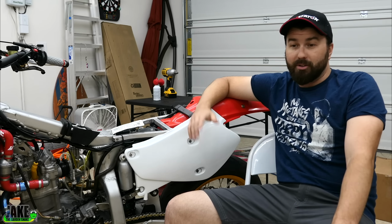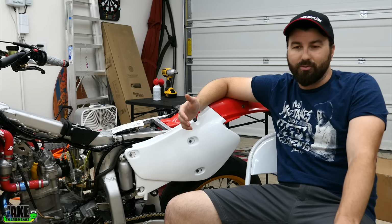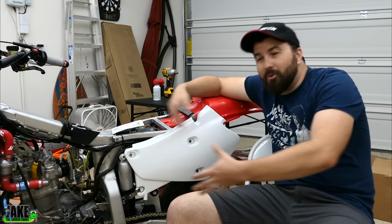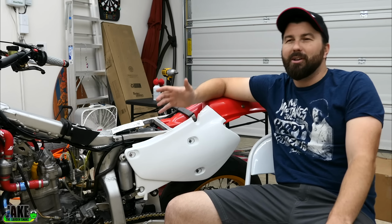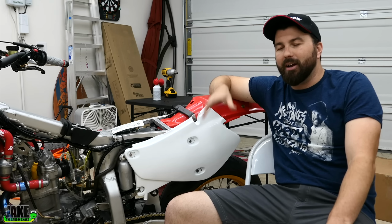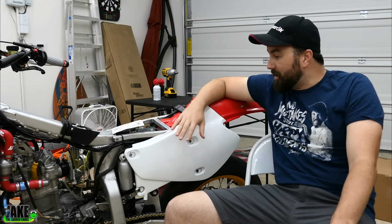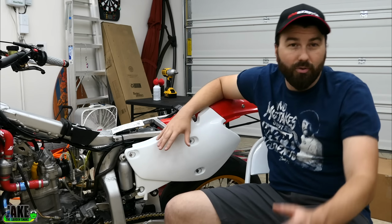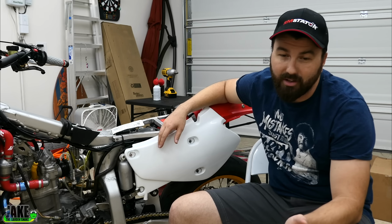It works well. But on certain bikes, it does make a lot of sense to do some sort of airbox mod. You particularly see it in the dual sports and dirt bikes. Just having the most airflow it could possibly get seems like it would be best, as long as you tune properly for it. But it's complicated. Let's not get into all the reasons why, but there are good reasons to be a little precautious about doing air filter airbox mods. I think the best thing to do is to look your bike up, try to research a little bit, and see what professionals say about it.